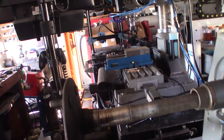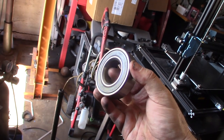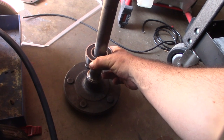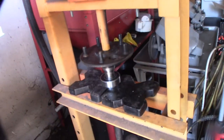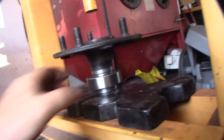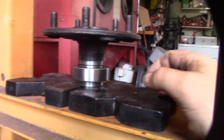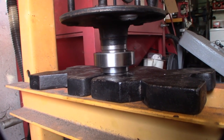I think this one will be fine. Remember when I showed you I took it off — it was spinning on the inner ID, the internal diameter. At least this one feels tight. I haven't pressed it down yet so it might be tighter. At least it's not loose on there like the other one was. The correct retainer plate came in, so I'm gonna press these on. Got a good seat — there's no gap, so that's good. The bearing had become loose on the shaft — that's why there was rust in between the gaps. But now the press is on there tight and not spinning.